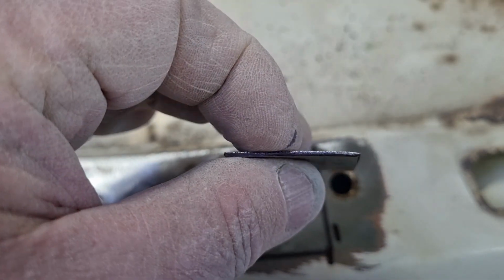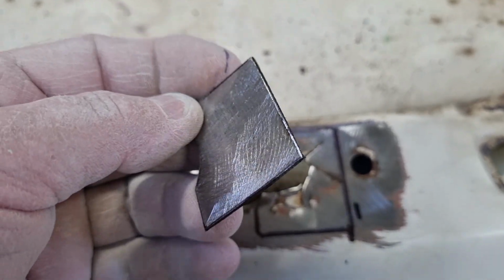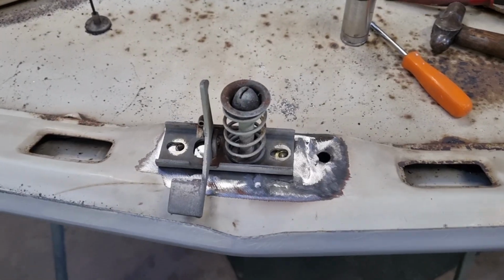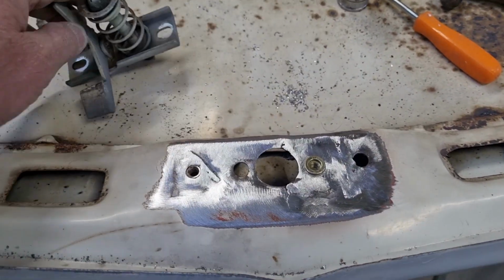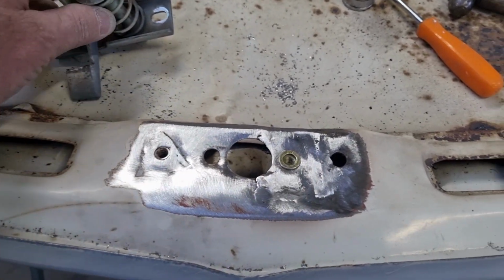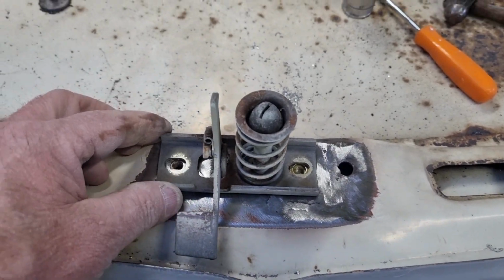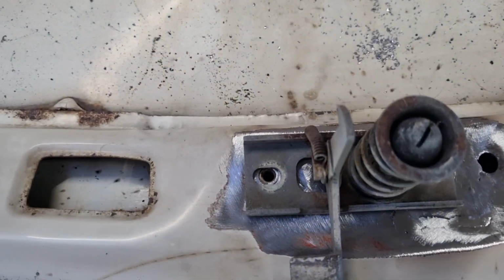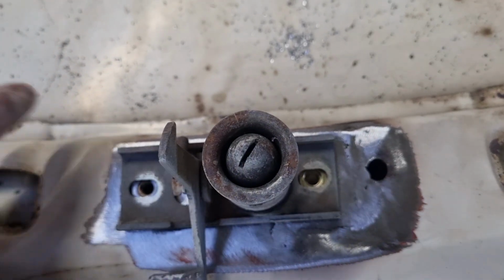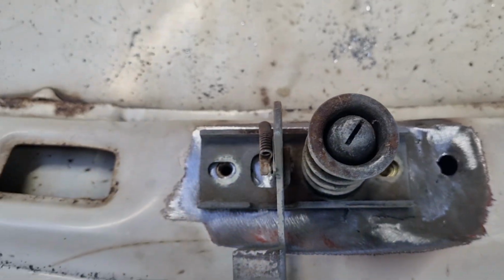Bit of genuine Chevrolet GMC replacement metal, so it's about 4 times thicker than the Datsun. Let's go. All done. Got an M6 riv nut in there, so it sits a little bit proud, which will lift the bracket, the clip, slightly up, but it doesn't matter, it'll still latch fine. So got those holes nicely centered, gives a bit of adjustment sideways once the bolts are in place. All good.